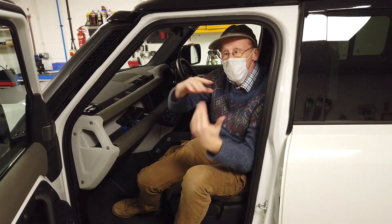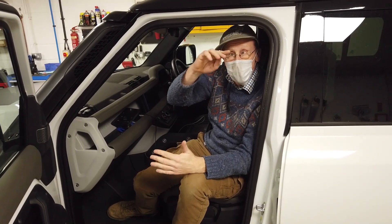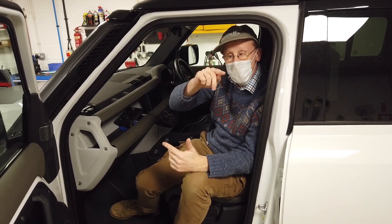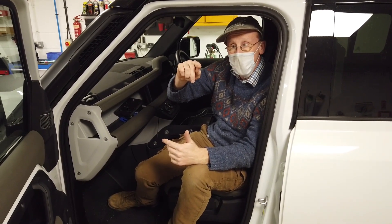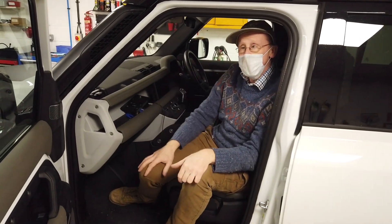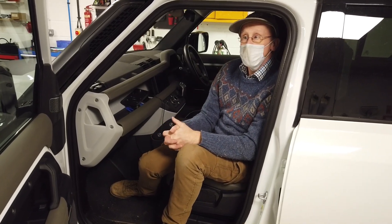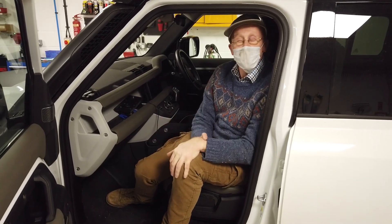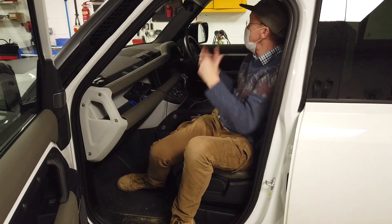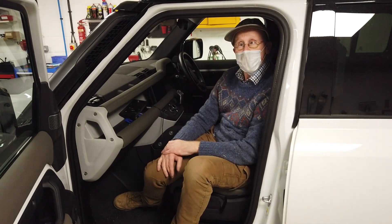I'll take it out for a drive. I want to look at the battery voltages as we're driving along — it should go up to 14, and then the smart alternator should kick in and turn the alternator off, and it should drop to 12. Then I'll park up and leave it, and see how long it takes to go to sleep. I'll get in and drive it, download some data, and we'll have a look at what it looks like. It's recording now, so I'll get out and take it out for a spin.